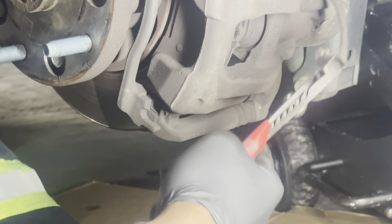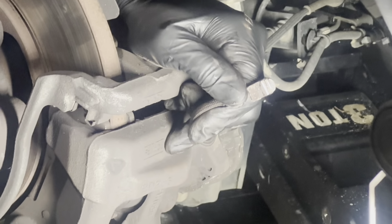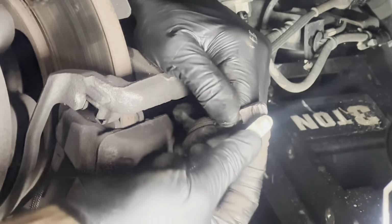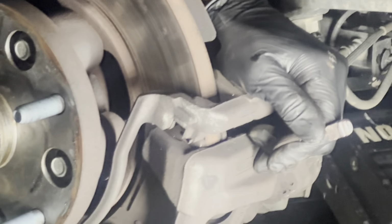I'm not really concerned about breaking it because I got a new one, but you can see this one's been already breached because it's shaved off. If you compare it to the new one, this one's sort of got a head on it. So once it's been breached, you got to replace it. So make sure you get a new wear sensor. Actually, they come with the brake kit,